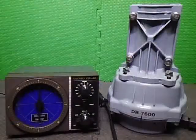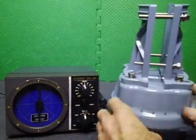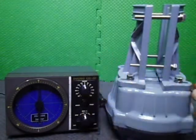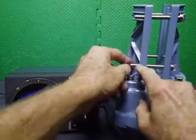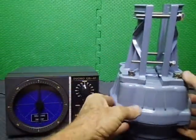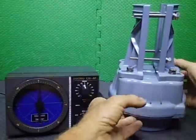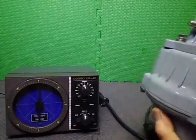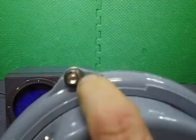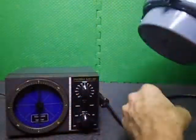We're back - this is now all done. I've chucked on a nice clamp to show you how it all goes together. As mentioned before, these have all got the recoil inserts in here. I do have lock nuts for these just to lock it off if need be. I'm using all new stainless steel hardware with socket head cap screws for the base into the bearing rings.